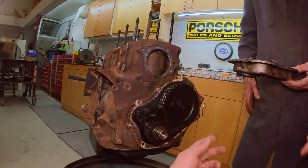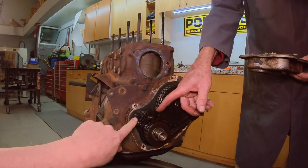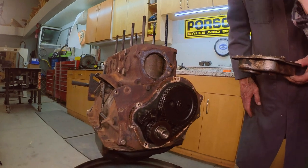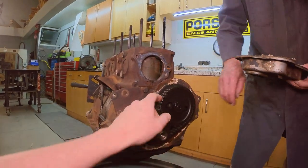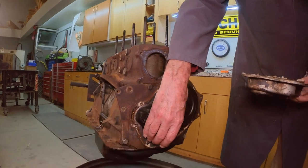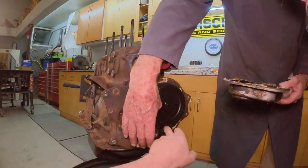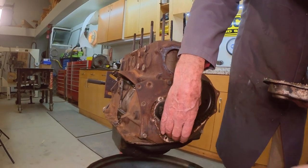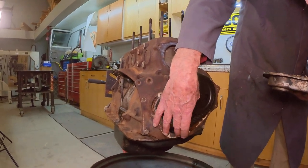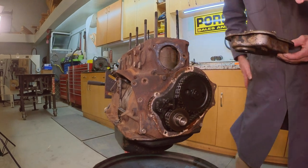Yeah, you can move it. It was pretty loose. There's no oil pressure on the tensioner. Right, there's an oil-fed tensioner on it. So that's why, rotating it by hand, we felt all that slop in the timing set. You want me to get that off? There you go. I'm going to take the key off, I guess. There's no opening in there.